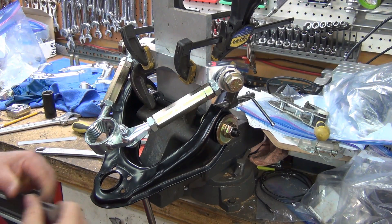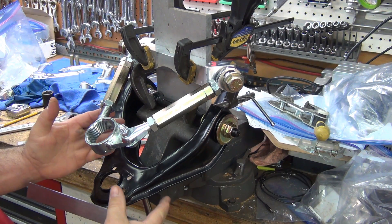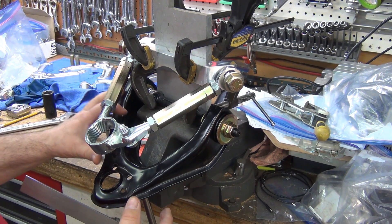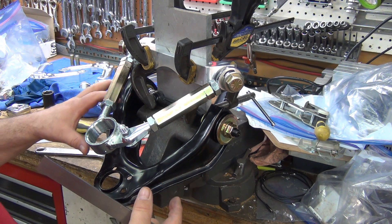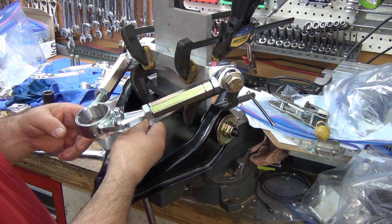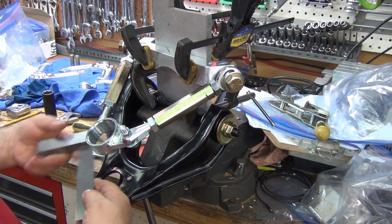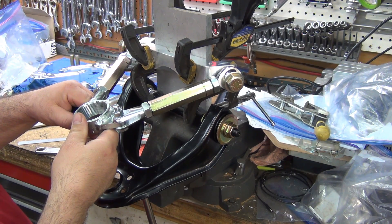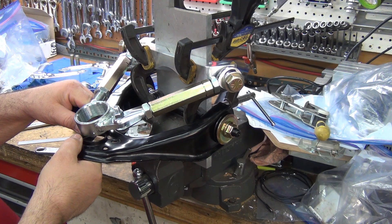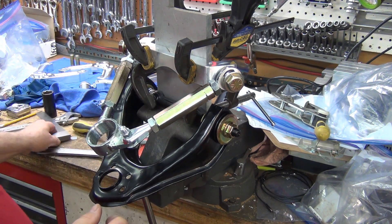I've been doing a little check here — it's an optical illusion with this front end of the arm. The left side, which is actually the front, is the driver-side left arm. The bump stop under this side makes it look significantly bigger, leading to an optical illusion that it's longer. But when I got in here with a square and marked the middle, the center of this ball joint hole lines up with the center of the cross shaft.